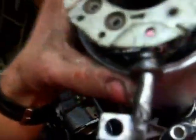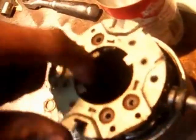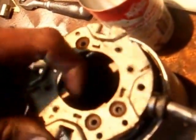Now I'll show you the brushes just for interest's sake. They're pretty worn. You can see there, they haven't got much meat left on them, they haven't got much spring in them either. Especially these two on this side, they're very worn. So they would be due for replacement, but that'll be another job for another day. So thanks for watching. I'll see you next time.